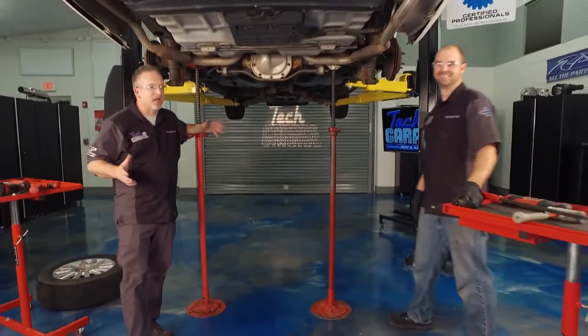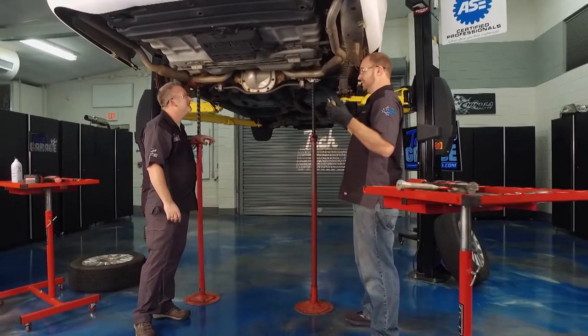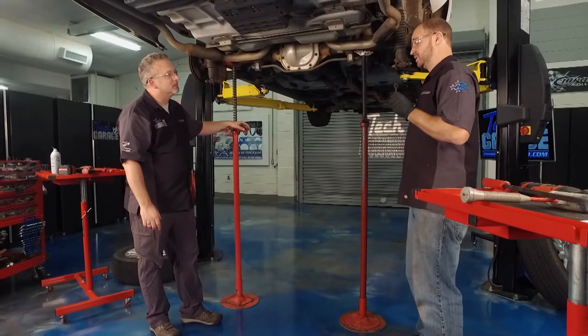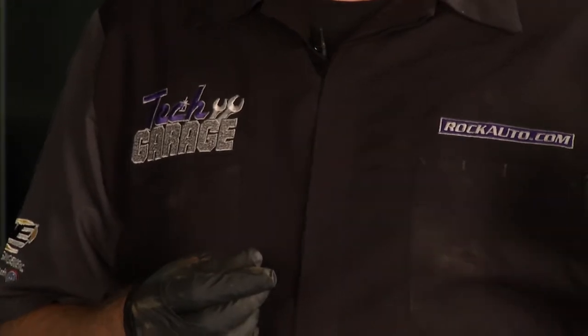It's exactly what we thought it was, John. We checked underneath, and these airbags are flat as a pancake. They are. What we have to do now is take them out. The first thing we need to do is on top there's a clip — it's a little bit of a pain to get off. And even more difficult, if you try to take off the solenoid without taking off this clip first, you're going for a world of hurt.